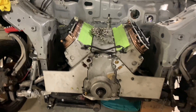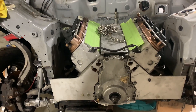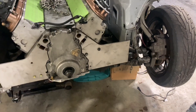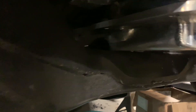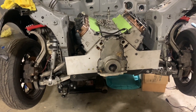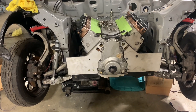My original plan was to come off the frame rails with the motor plate, but the motor sits lower than I originally thought. So what I'm going to do is build a box similar to what Jason did on the Grand National — off the frame rail down a little bit lower, and probably come off this angle here to give it some more support. It's probably going to be an inch higher just to keep the oil pan off the rack. I'll come up maybe half an inch to give it some clearance. Without the trans on it it's pretty much just supporting itself, so once I do that I'll start tacking up stuff in the engine bay. I'll get gas for my small welder in the morning and build the box tomorrow.